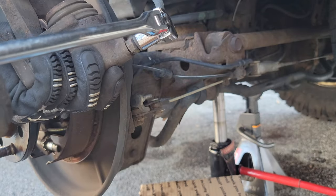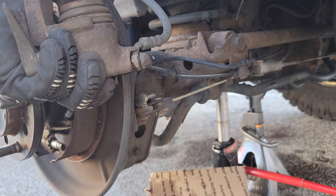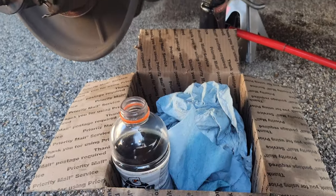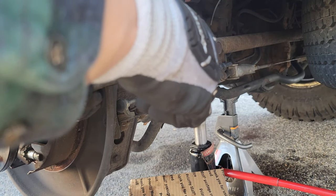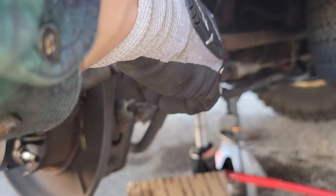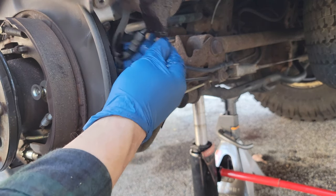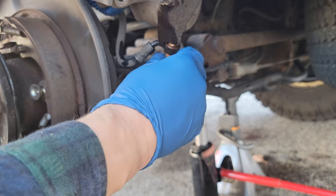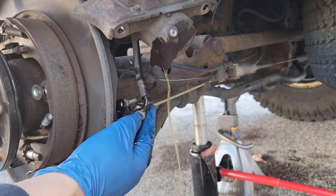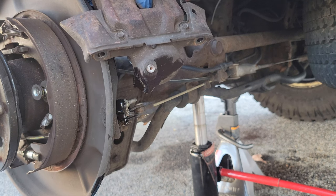Because I broke the bleeder valve off, I had to take my 14 millimeter socket and drain all the fluid out of the banjo bolt. I have a cardboard box with some kitty litter and shop towels and a collection bottle down there. Brake fluid is very hazardous — you don't want to get it on your skin or on the pavement, so make sure you use something absorbent like kitty litter to soak it up. You'll notice the brake fluid doesn't come out of the brake line too fast, mainly dripping out of the caliper itself as we drain it.